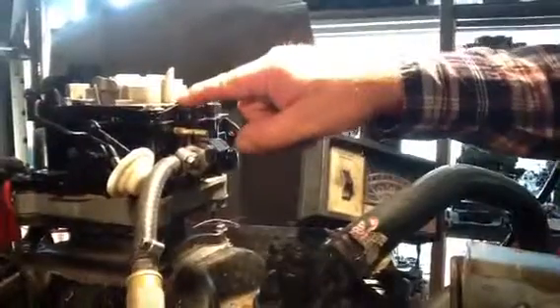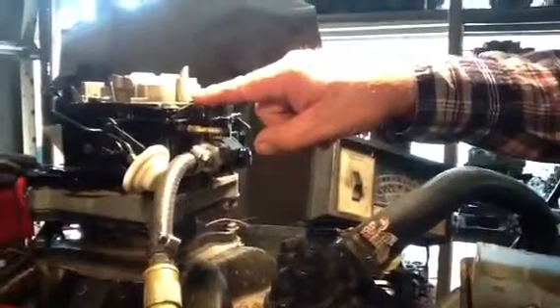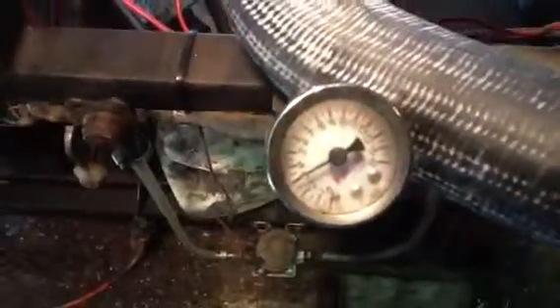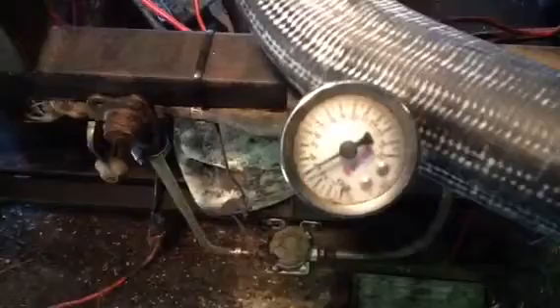But these guys get them and they put them on their car and they don't run. They either got too much fuel pressure — 3 pounds maximum. Timing is off. They got dirt in the fuel, they put more dirt in the new carburetor. They don't care. They install them, they put bad washers in here, they put washers underneath there. Their motor's no good.